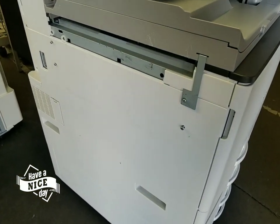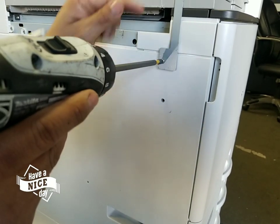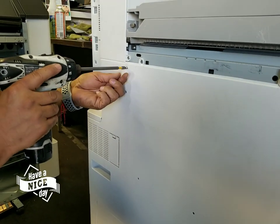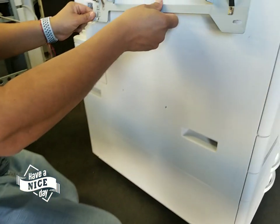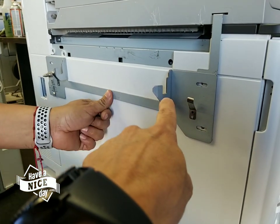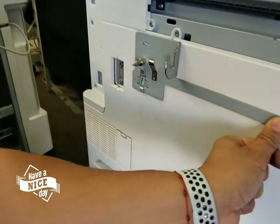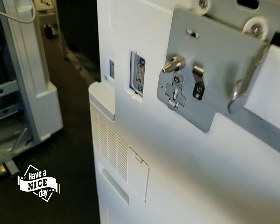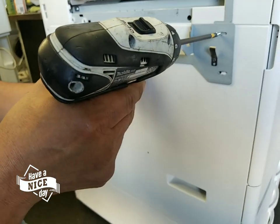What we need to do first is remove the four screws that we placed there. We put these screws in place so they stay there and all you have to do is remove them. We're using a power screwdriver, but you can use a regular handheld Phillips screwdriver. When you put the bracket in, just remember on the SR-3160, the hooks are going to point upward and the little cone shape unit that sticks out is going to be on the back towards the back of the machine.